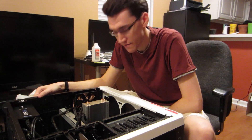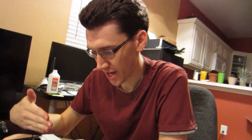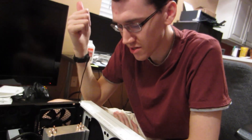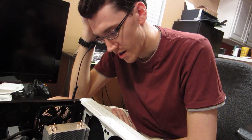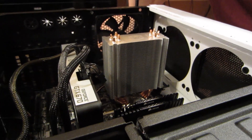After much swearing and frustration, it occurred to me that when the heatsink was mounted that way, it was pretty much touching the RAM. That's probably not good, number one — but also, number two, it's covering up the expansion slot in case I wanted to get more RAM. So I was like, I probably need to turn it the other way. We had to take it off, re-clean the CPU and the bottom of the heatsink, and then redo everything over again. But now it's in there.